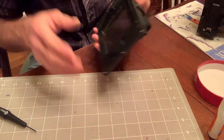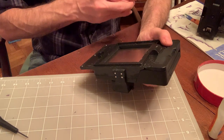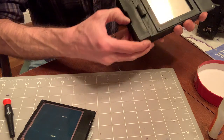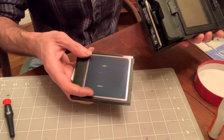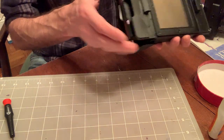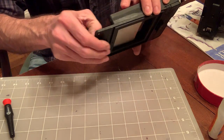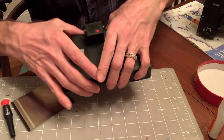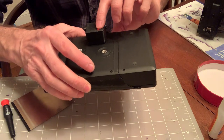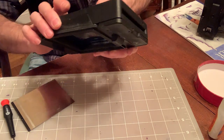We're done. All right, so I will demonstrate how it's attached to that, and I have a separate video on how to use these things. So now let's see if this actually ejects. This is a cartridge with used film. I have a few frames in there. Dark slide. So I'm gonna push this button. You have to use your nail. It doesn't go out a lot, and this is on purpose because you don't want to push it accidentally and eject frames. Right, so